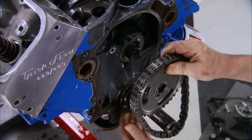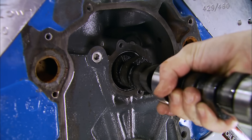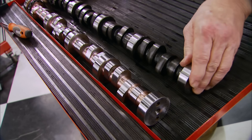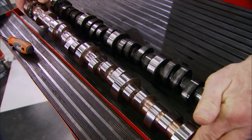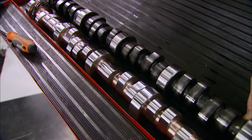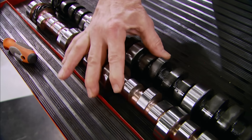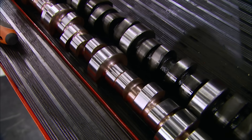This hydraulic flat tappet camshaft was a good choice for a budget-minded performance setup, but not for our new power plant. In its place is going this Comp hydraulic roller that was spec'd out for us by engine builder John Cozzi. The gross valve lift of this flat tappet is 0.494 compared to 0.685 on the roller - you can see the different shapes of the lobes and why this one's going to hold the valves open longer.